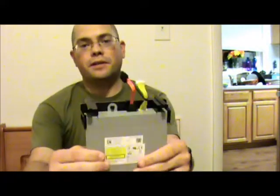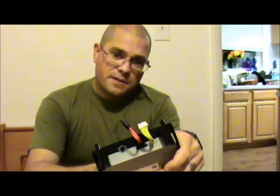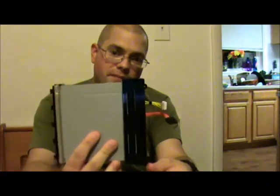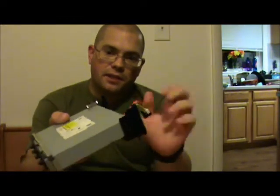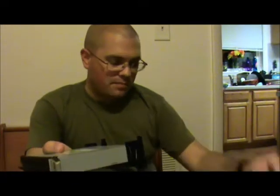I've got too much going on. Alright, so when you take the Blu-ray drive out of the Xbox One, if you've seen me unplug an Xbox 360's DVD drive, then you'll know how to unplug this. It's exactly the same. Now then, differences. It is physically smaller. Additionally, it has this lovely little plastic thing on the back here. First, what we're going to do is unplug these cables from the back of it and set them aside.